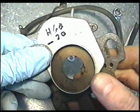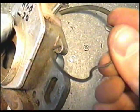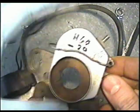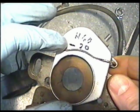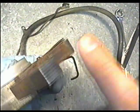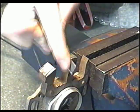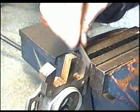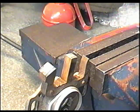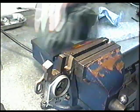Put the cover back on — it fits in one spot, goes like this, and clips over. You'll have to remove this again when you time the points on the engine. Now clean off the bracket with sandpaper so the new coil goes on nice and smooth. Then spray a bit of liquid wrench and give it a quick wipe to make it nice and smooth.